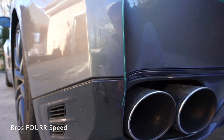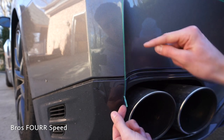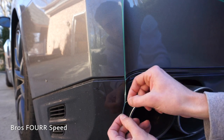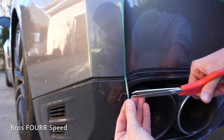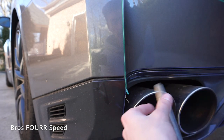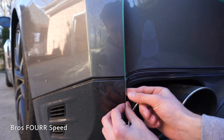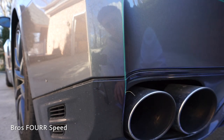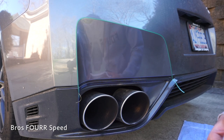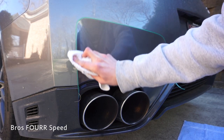Now what I like to do — I always have issues when I try to activate the tape the normal way. You're supposed to grab the whole thing, put your finger here and pull really hard, and that pulls the filament through, but I can never make that work. So I go on the back end and just peel off the actual filament. Getting the filament off, I take scissors and cut a perfectly flat line right there, then pull up the tape just a little bit more and cut a slot directly in the center of the tape. Then pull the tape straight down, put everything right back down where it went, and pull the filament right through that slot. Give it a little pull and now it's started and ready to go. Before we lay the vinyl back down, I'm going to take a clean portion of the rag with cleaning solution and re-clean all the plastic, because I just had my hands on everything and we don't want any of that oil still there.